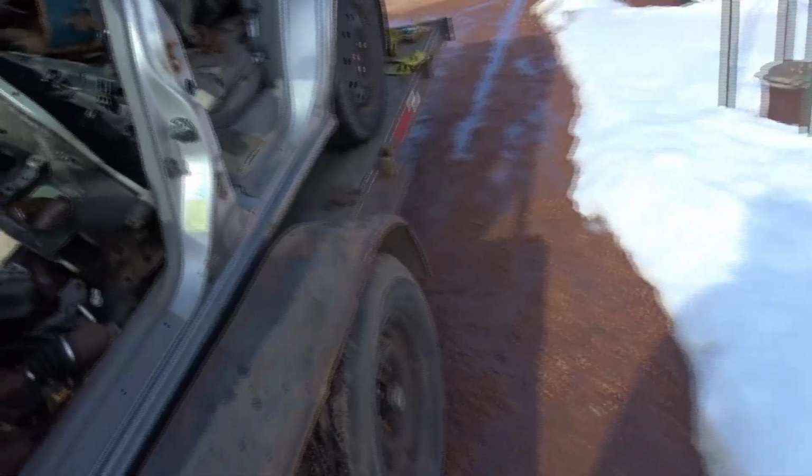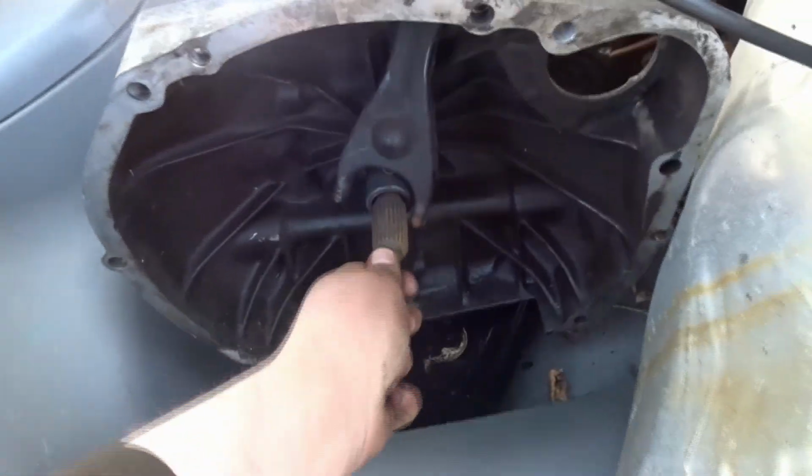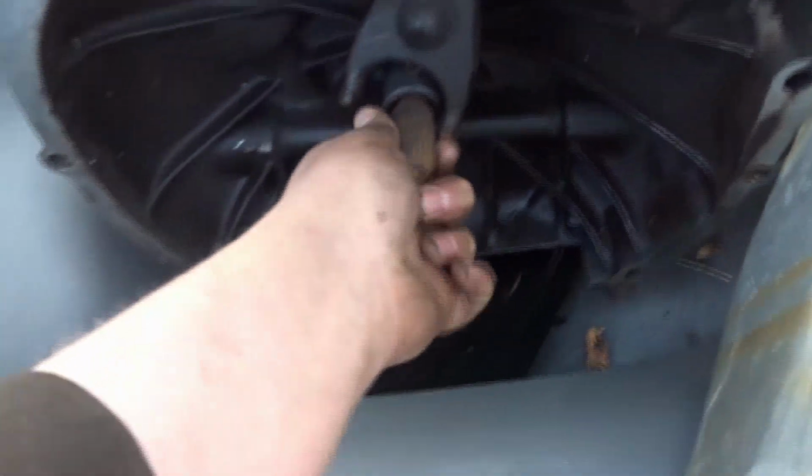Now, thinking that it won't, this car had this POS in it. And of course, this is exactly the transmission, and the code matches. And you can shift it. Kinda. Oh, crazy. It's gonna make a liar out of me. Maybe not. Well, anyway, if you come back here, of course there's no struts in that. That's not supposed to do that. That bearing, the input shaft bearing, is toast. So that means that thing's gonna howl or not work very well.